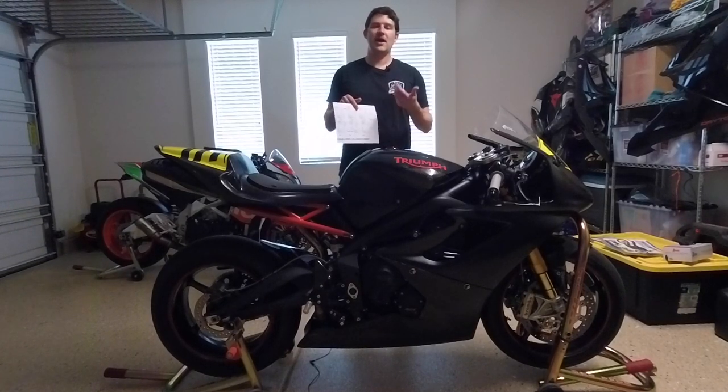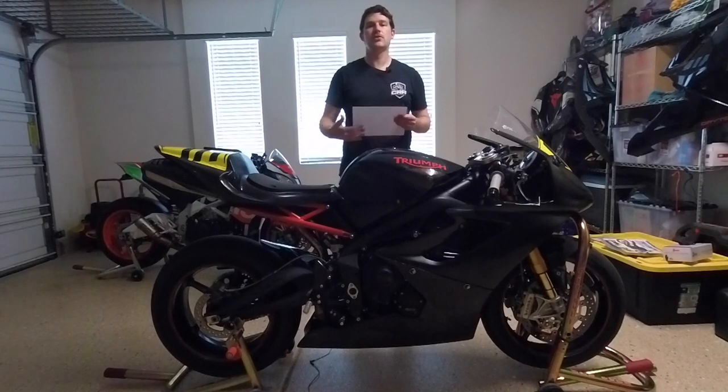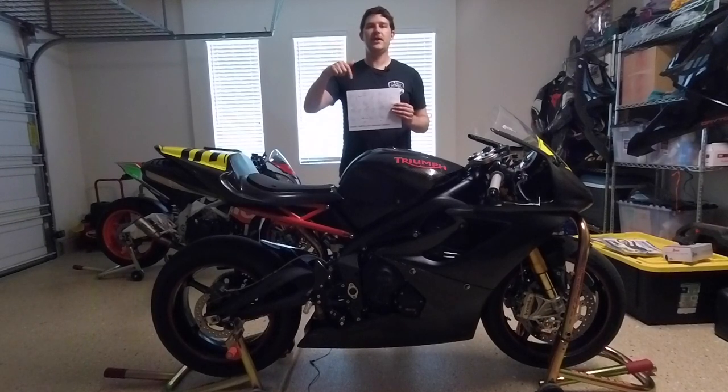Super easy to keep track of. Keep a pen handy, and then you can cross out and put in your new clearances too. Once you have adjusted the valves, put everything back together and go back to do your recheck. I'll go ahead and throw a screenshot of this up on the screen right now. Feel free to pause the video, go full screen, take a screenshot of this so that you have it for reference. I'll also take a look, see if I can find that thread again on triumph675.net. Drop a link to it down in the description below.